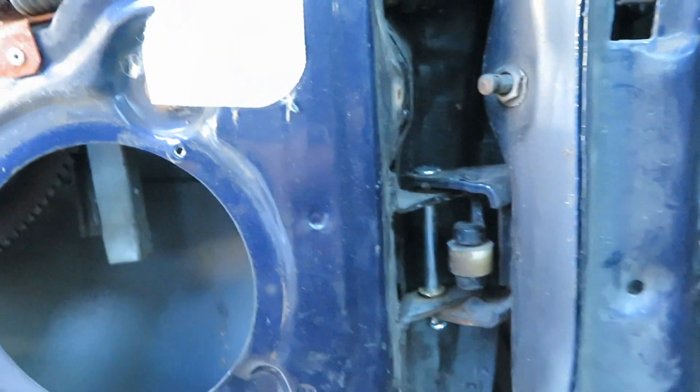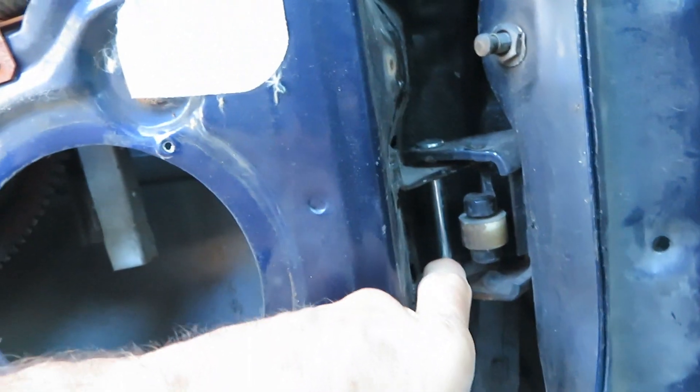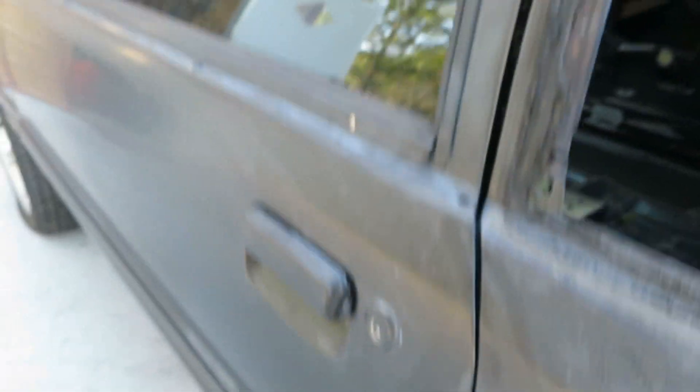I'm probably not going to paint the car myself — I don't know enough about bodywork and paint to do that. But I want to get it prepped so that whoever does do the paint, it's not going to cost me as much if it comes in already ready to go. I also did the pins for the doors — the bottom pin was bad but the top one wasn't. I put new bushings in there and now the door is really good. It doesn't move up and down and lines up nice.